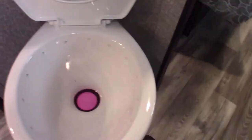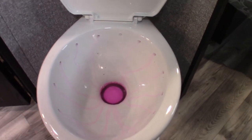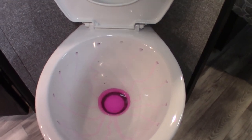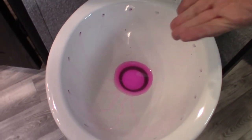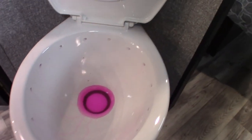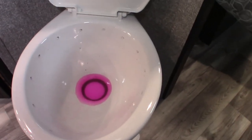The toilet works like any other RV toilet. The black tank is directly below — that's antifreeze coming out right now because it's winterized. The rule is you have to have chemical and water in the tank before you start using it, otherwise the smell will be terrible and it can get clogged up. After you hook up your trailer, power, and water at the campsite, come in and put one dose of chemical in the bowl, then step on the pedal and let about a gallon of water swirl into the tank along with the chemical. If you dump your tank during your stay, you repeat that again — you can't use it dry.